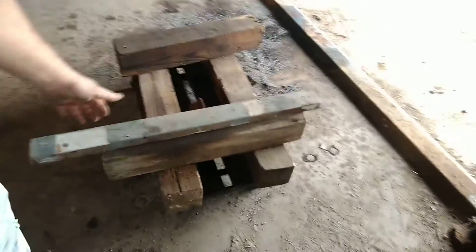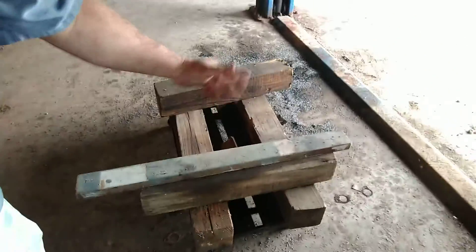Just a little piece of advice on what I did on the front end — because it was going to hang down — I took my floor jack and lifted the lift up off the lock, rolled it underneath the tire, and cribbed it enough to where when I set it down it'd take just a little bit of load off that corner. Then I did my shock, picked it back up, went to the other side, set it down a little bit, and changed that shock.